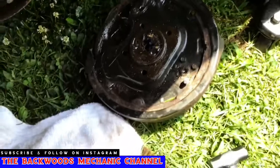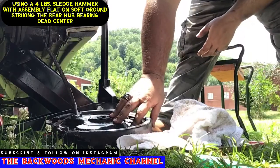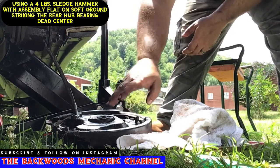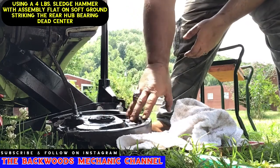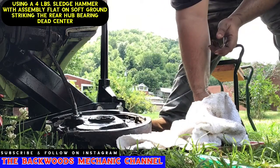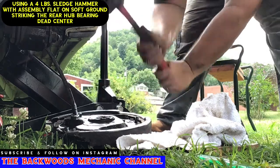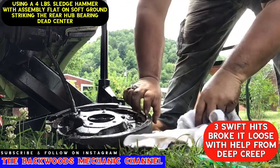Well, we got enough room to maneuver this thing around, start beating on it, and get it knocked out of its housing here. Laying this one down on the ground. Your big thing is making sure that you break away the rust. It's the same thing on the back of this flange here, on the back of this housing, that it was with the drum. You got rust on the back side of this in between these bolts, and you're going to have to beat the mortal dog out of it to get it loose. I like giving it a good few swift hits with this 4-pound sledgehammer right smack dab in the middle of it. Right there you go. Breaks it loose.